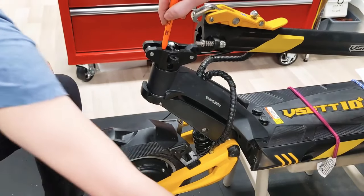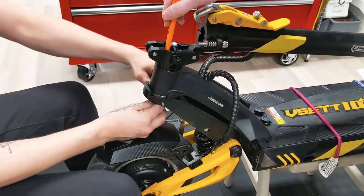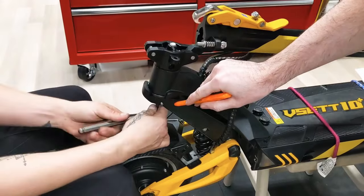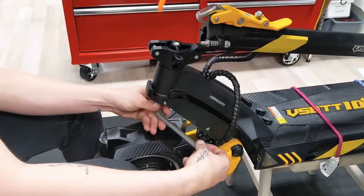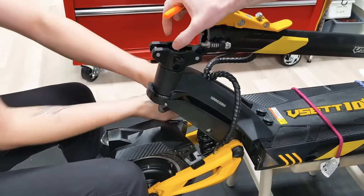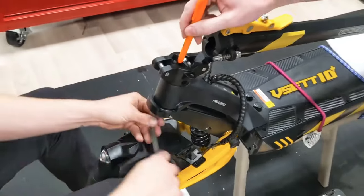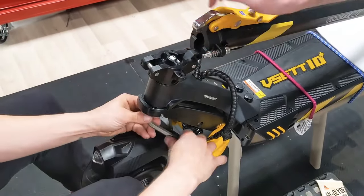This collar right here fits over the top of this swing arm. The swing arm fits up and the collar goes over it, and these two screws on the side go through and hold everything together. Inside of here is one of the points that could be causing noises, so we're going to grease inside of there.